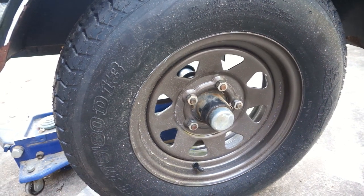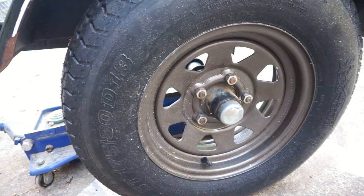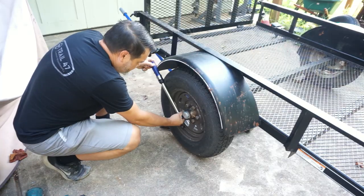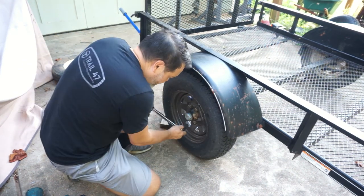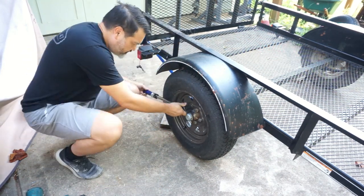We've got the wheel onto the axle with the lug nuts hand tight. We lowered it down and now we're going to set the torque specs from the manufacturer — it goes from 55 to 75 foot-pounds. We'll start with 55 and then go up to 75 foot-pounds, and then we should be good to go. We've got both tires on, torqued to spec, and we've actually got an extra tire we can use as a spare. We just have to create a holder to mount to the tongue at a future date.